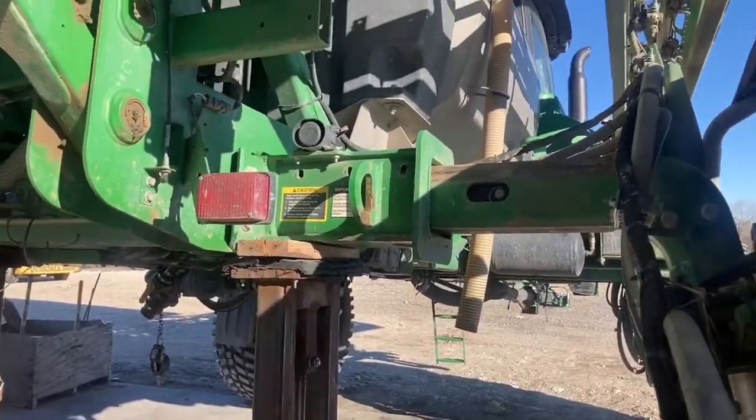You really want to make sure you lift it up with the forklift, otherwise that thing will tilt because you've got all the weight of the tire when it's pushed out and it'll just pinch the end of it. We've tried using a floor jack or just prying it up and that just doesn't seem to do it. Get the forklift and you can just move it a little here and a little there — that seems to help a lot to get it out.